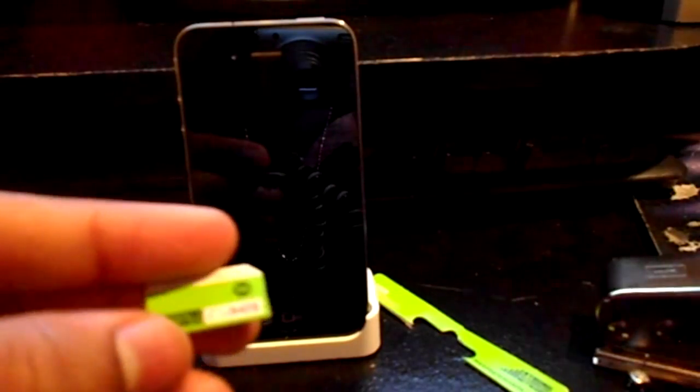I'm going to go ahead and back up, open the SIM card container. I'm going to remove my SIM card from it. I got my Simple Mobile SIM card with some instructions taped to the back. I'm going to go ahead and remove the SIM card and insert it into our micro SIM cutter like so. Put it in backwards — going to fix that. And clip it. This is our micro SIM.